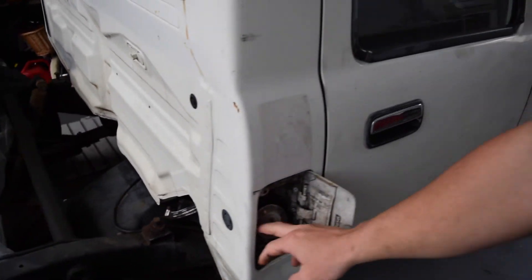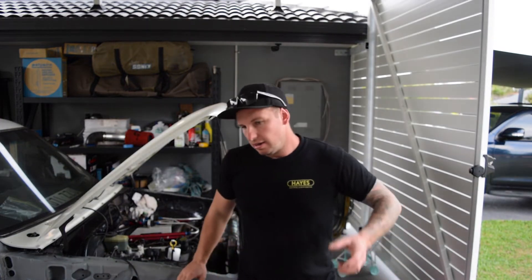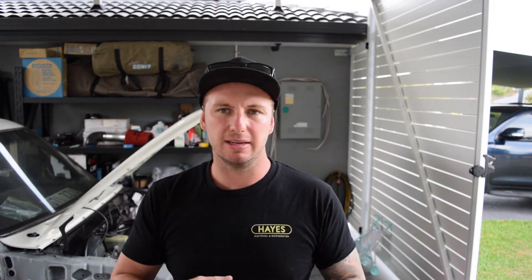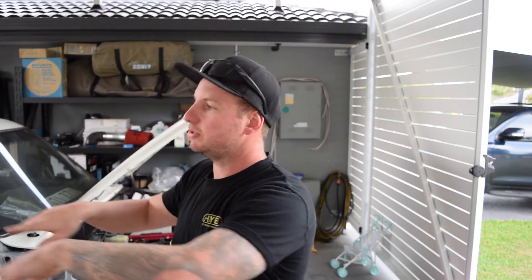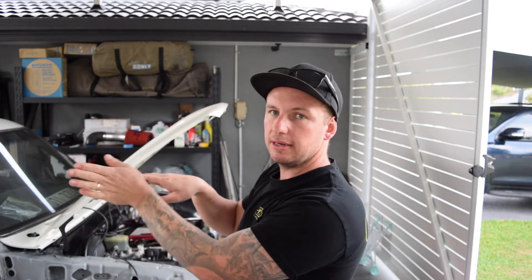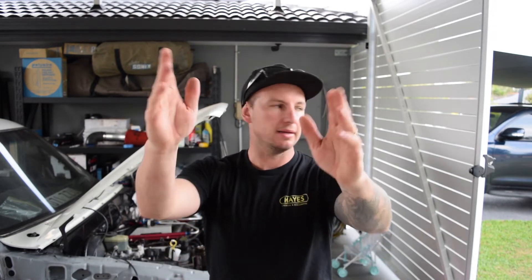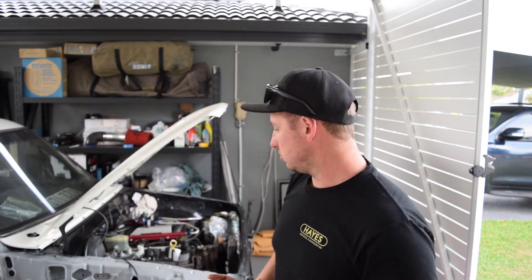This leads into the fuel tank. I'm taking the old fuel tank out — it's been in there about 25 years. I've started undoing the bolts with a jack holding it. Removing it will allow us to run dual exhaust, one each side — I want three-inch tips out the back each side. A few mates have said why not just leave it, but I want everything new and easily accessible from the back. I also want the exhaust to run equal length straight out the back — you can cross them over and poke them out the back, but ideally you want equal length so exhaust pressure is the same both sides.